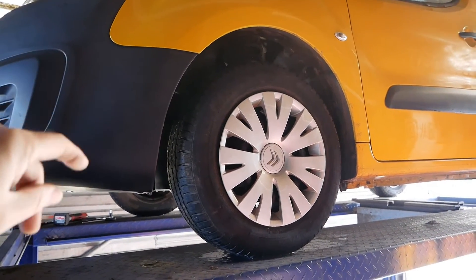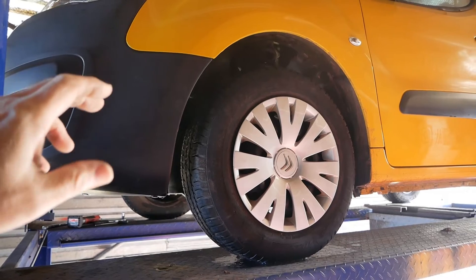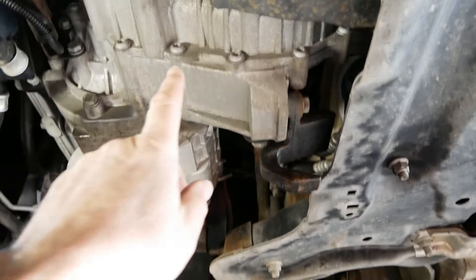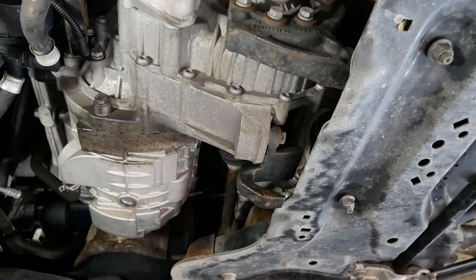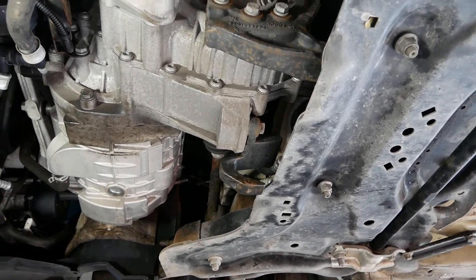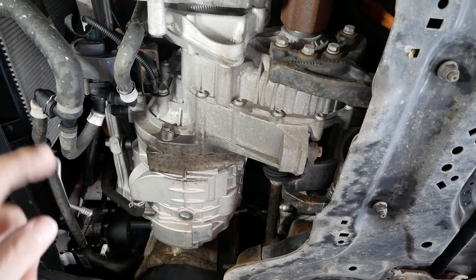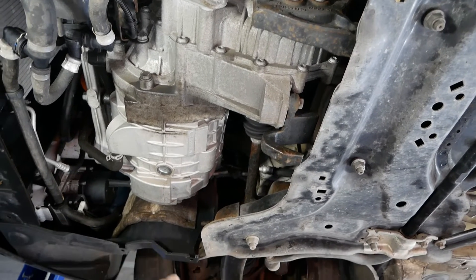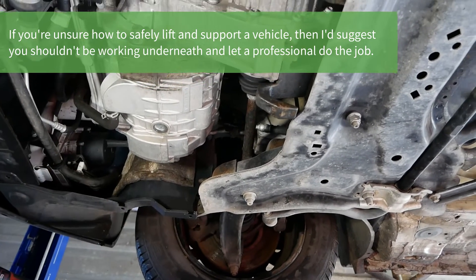The manufacturer says that the gearbox is sealed for life and oil changes are just not part of the service schedule. But evidence is showing with other EVs that changing the oil in this reduction gearbox does have a benefit. As to when it should be done — this has only done 27,000 miles so it's a bit early — I would say every 50, 60, or 70,000 miles or so. These vans don't have an under-tray, so it's a job you can do yourself. You don't need a lift; even just driving the wheels up on a curb, a bank, or some blocks — even house bricks getting it up three or four inches will be enough.